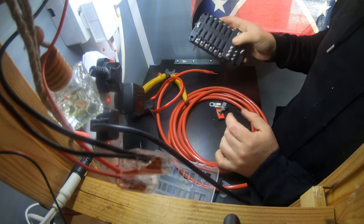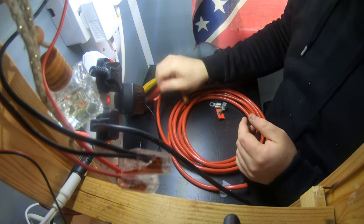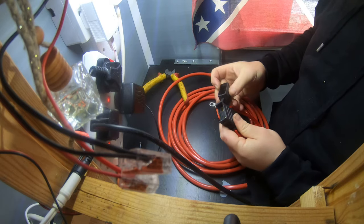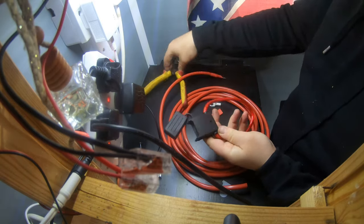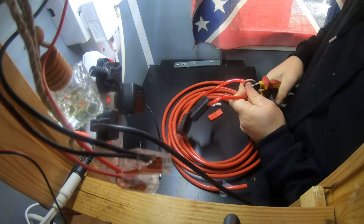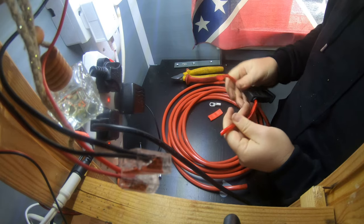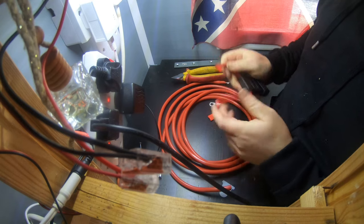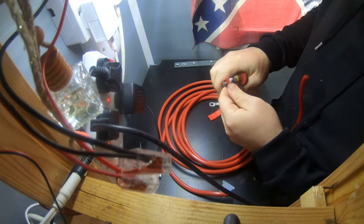Yeah, that's it. So I'm going to start doing that now, but this is going to be a 75 amp fuse, the other's a 100 amp fuse, so if something goes wrong it should just take this fuse first, sort of segregates it a little bit. So anyway, I'm going to cut this. Like so. So one end of this is going to go on the battery, the other end needs to join onto that. So I'm going to have to get a bit creative, I think.